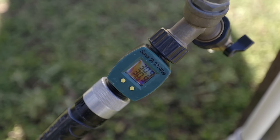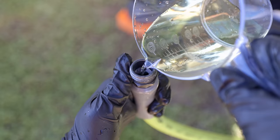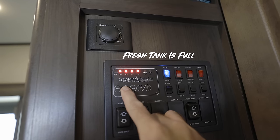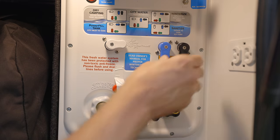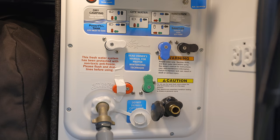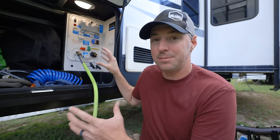I can gauge it better when to stop and add a little more bleach into the system. The knob configuration matches the power fill tank setting, except for the red one for the water heater — we still want that in bypass. That's the only one that's going to be different from the diagram on your Nautilus panel. So we're just going to add bleach three more times, and then the solution is ready to get into the lines. If you need to put a little piece of tape on that red knob so you don't accidentally turn it during the other steps, that's not a bad idea.